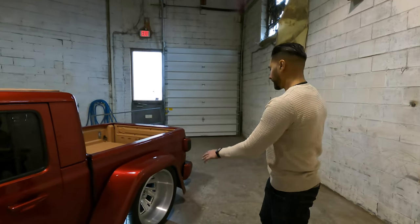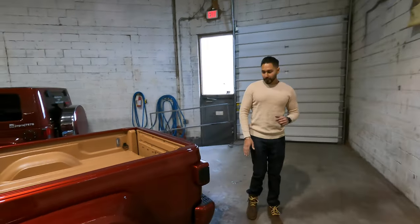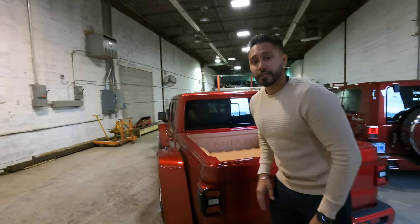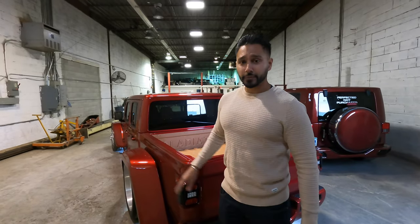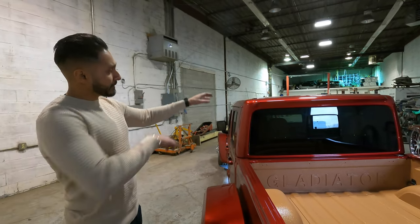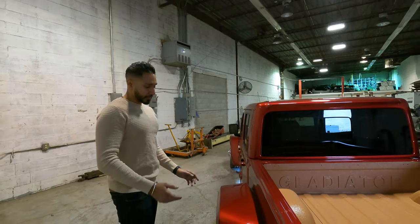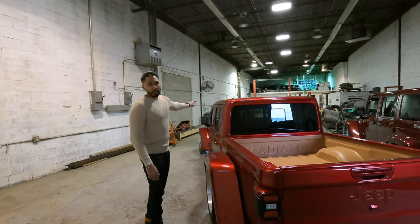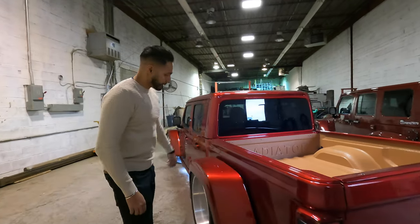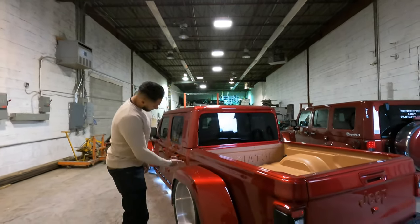Before I talk about the roof, I want to talk about that rear custom flare. This is all metal. If you look at the profile of the actual flare, it matches the front flare. We were really confused about how to make it look factory, so the best approach was to mimic the front flare. We took the right front flare, put it on the left rear to get an idea of the transition, then used Bristol board to copy the actual profile of the front flare, made all our reference points, and fabricated from there. You can see that in one of our two-part videos. These are all metal and the inside of them is completely bedlined.